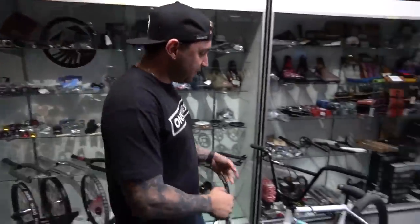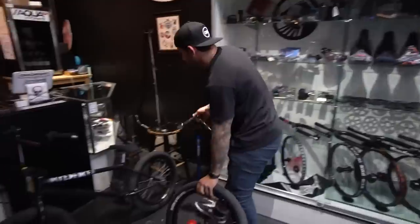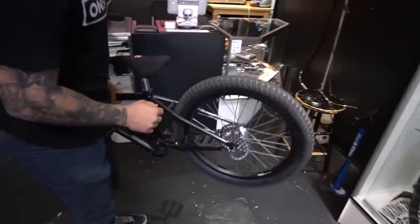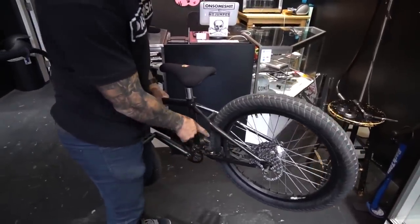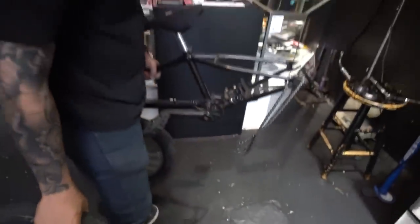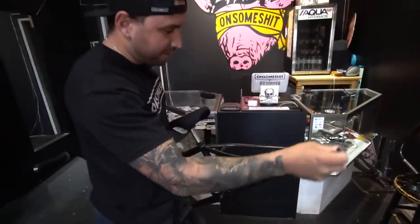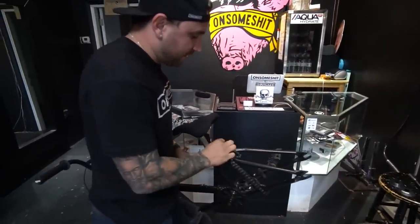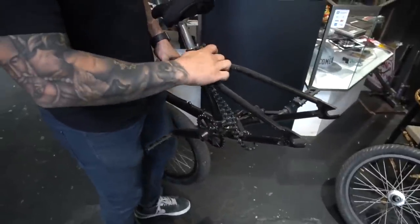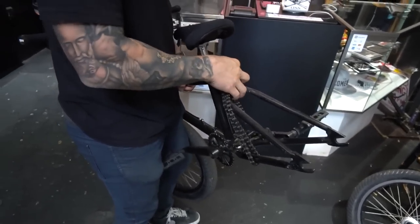I have already conveniently loosened up my front wheel, so that's going to come right off. You don't want to ride like that — it'll kill you. Next up, you have to remove this back wheel from the Chris Longmobile. This one has brakes just like my bike, so you have to remove the straddle cable that goes here, then this wheel will come right off. I'm not even going to bother taking the chain off. Adam saw us doing this earlier and was calling us for not taking the chain off, but it's a lot of work. So basically all I'm going to do is move the chain over and put it through his top rear triangle — that should keep it in place.